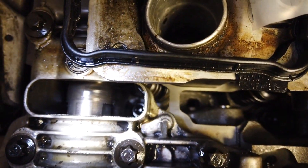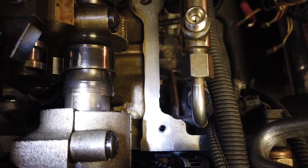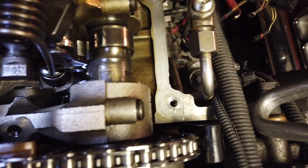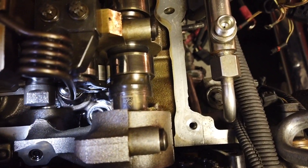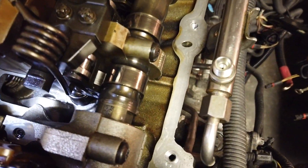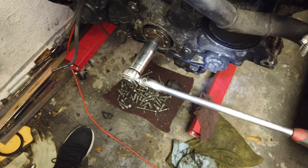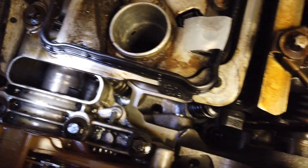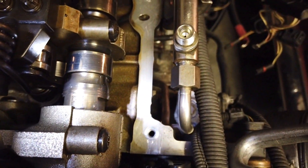There's a QR code on the exhaust side camshaft and a barcode on the intake camshaft — both have to be pointing up for TDC to be confirmed. My advice when finding TDC: don't try to force anything on your wrench at the hub, because some valves might be in the way and you can bend them. Now that we've verified TDC and the flywheel is locked, we'll install the timing chain tool.